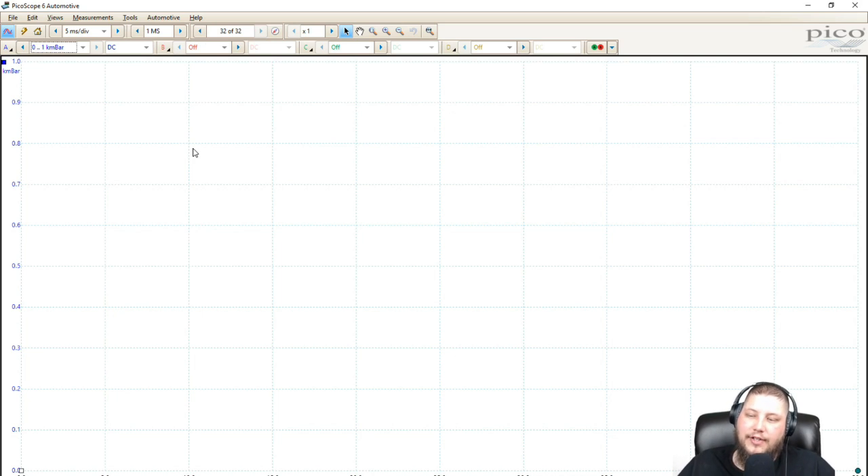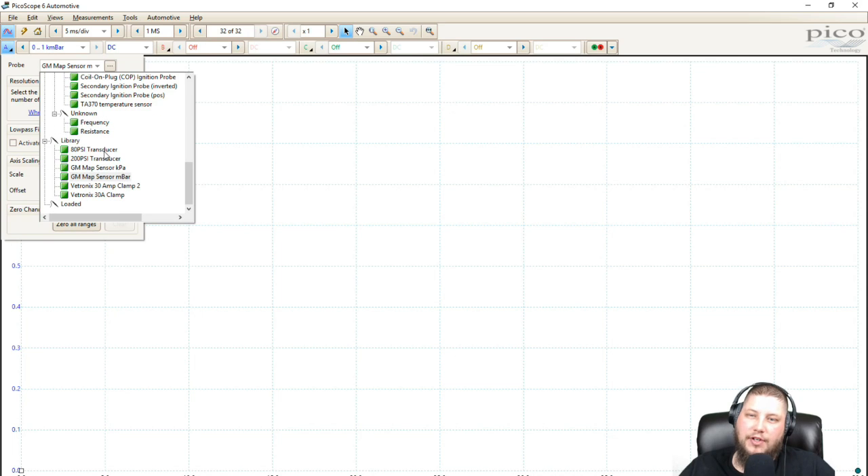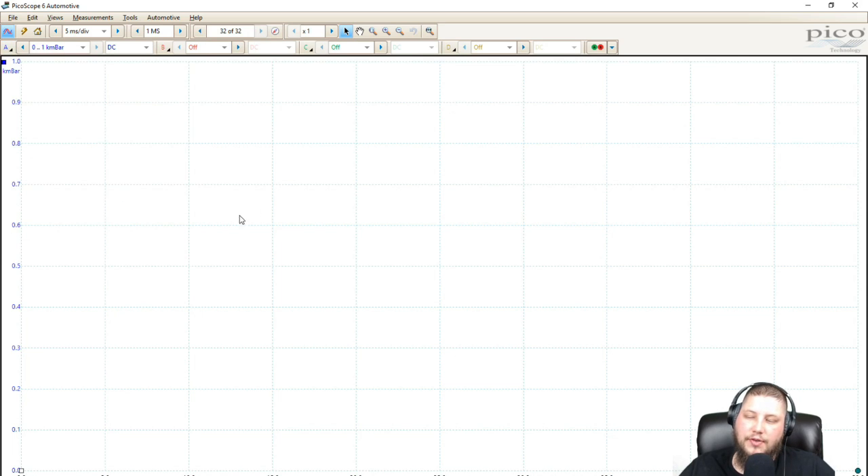So there you go — that's how to create custom probes, how to scale them, and what you're looking for, along with a couple ideas on things to use. As you probably saw, using that same voltage box you could power some transducers and create your own in-cylinder pressure transducers — that's a story on its own. But for the most part, if it's not an ATS, a Pico WPS, or a Snap-on, it probably is not a compound ratiometric type sensor. They usually don't do very well reading vacuum. You're going to spend a lot more time than what it's probably worth versus just buying a proper in-cylinder pressure transducer.